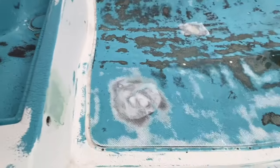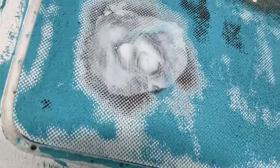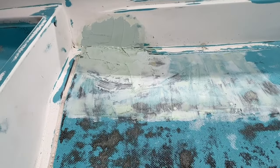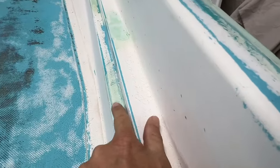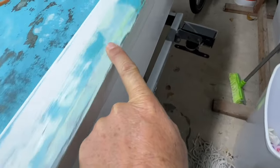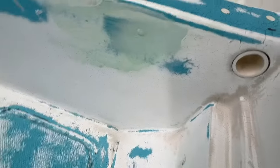Let's take a close look at what we've got here. We've been sanding and sanding and sanding. We've been patching holes. That hole got fairing compound. That hole finished got fairing compound on it. This one has lots of filler on top of that fiberglass patch — all that's going to get sanded smooth. We have patched all the little holes all over the boat. More fairing compound on the top edge, getting everything smooth. We're starting to fill in nicks, dings, holes.